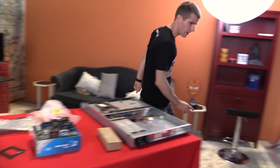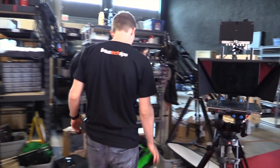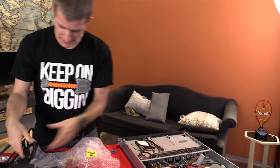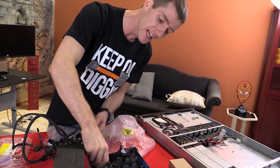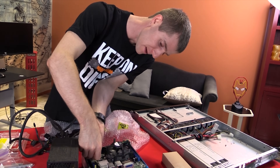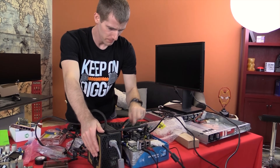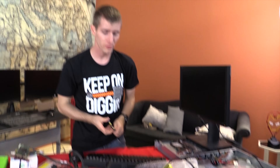For extra safety, I'm going to try a standard desktop power supply. I don't think the problem is my power supply. What I think the problem is — and almost nobody in the comments actually picked up on this — is this four-pin connector that comes off the 1U power supply that I plugged into a fan header on the motherboard, which I checked with a multimeter later and which appeared to be supplying rather than requiring power. Let's start with different RAM and see how it goes. When a motherboard dies, it can take other hardware with it — I'm really hoping it didn't kill our Xeon CPU.